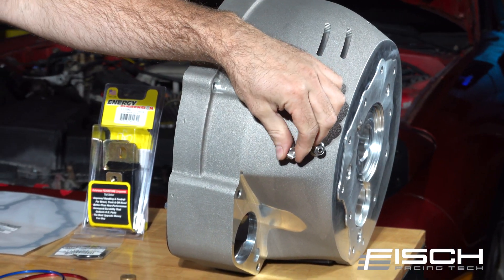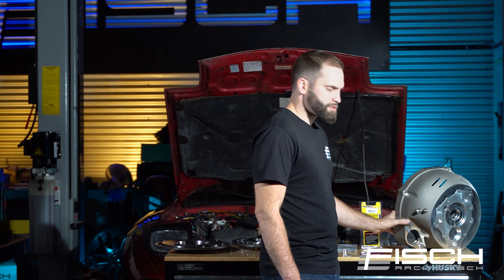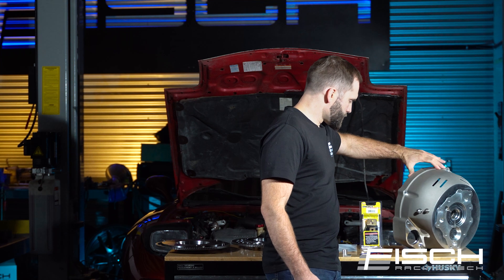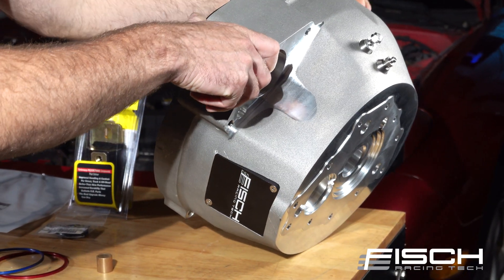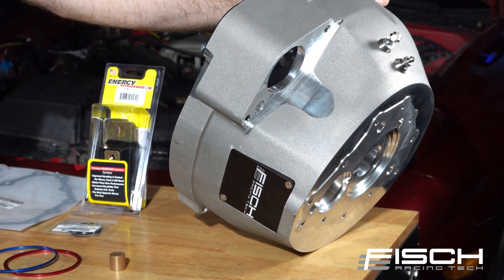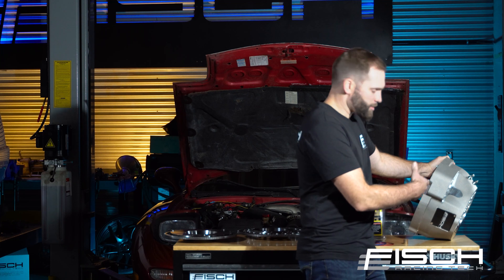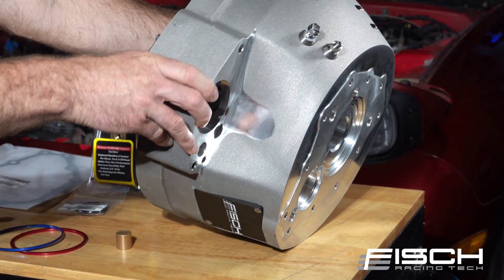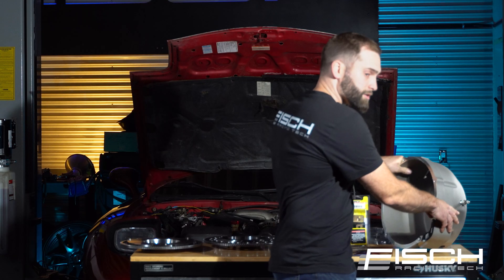One is a bleeder, one is the hydro supply line. It also requires you to use an RX-8 starter for quicker spool up and easier starts. It also comes with an inspection cover plate on the bottom, which allows you to check the engagement on your clutch. You can have it removed on hot days for a little more airflow, and there are slots on the top to allow more airflow through the cavity.